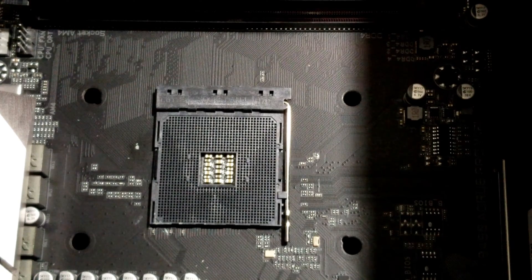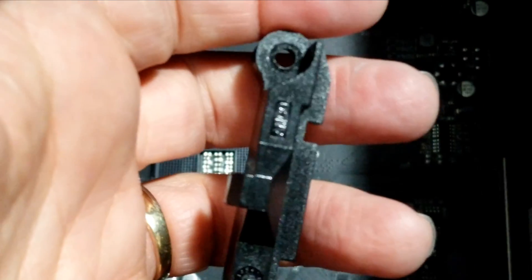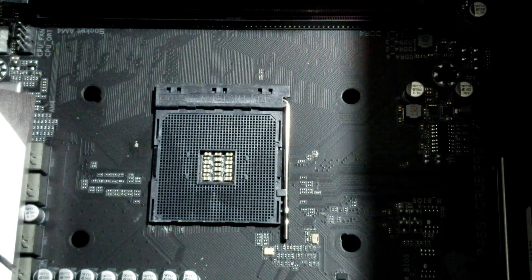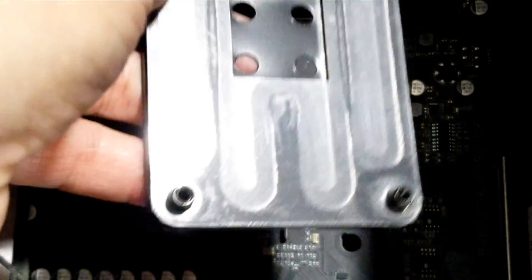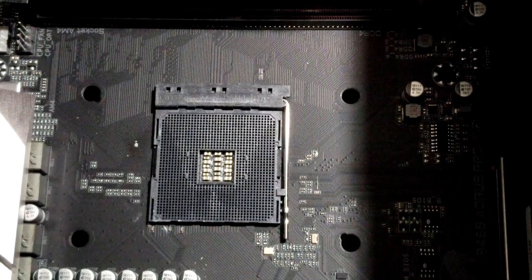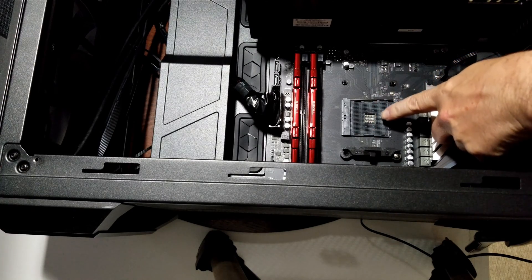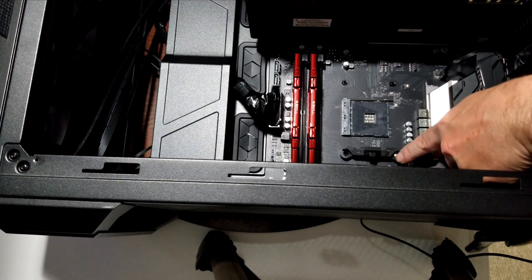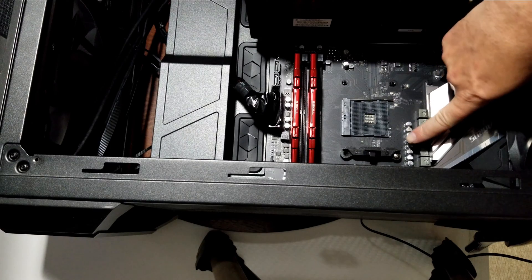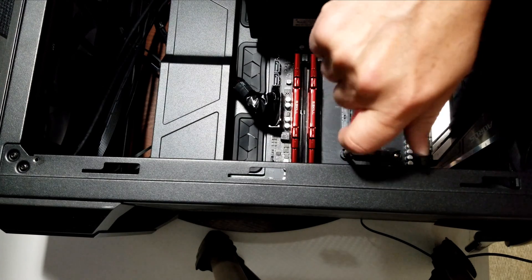One thing to remember: any time you've taken off your CPU and removed an external CPU cooler, you've taken off these brackets. Each bracket has two screws and you need four holes, so you need to make sure this piece lines up going in like this to align with your holes from the back. Then you're going to be able to screw those down. Hold it on the back while you put the back plate up — push this down, put your screw in, and fasten one side first. Once that's in tight, put the other ones on, tighten them down, and away you go.